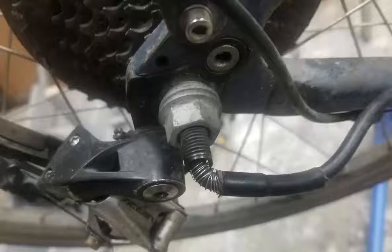Finally, as you can see in this picture, the wire bundle coming out of the motor appears to show some damage. Putting all of these clues together, we can be pretty certain that damage to the wire coming out of the motor was causing the problems.